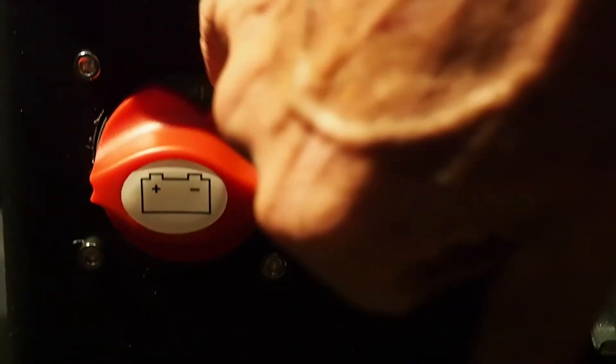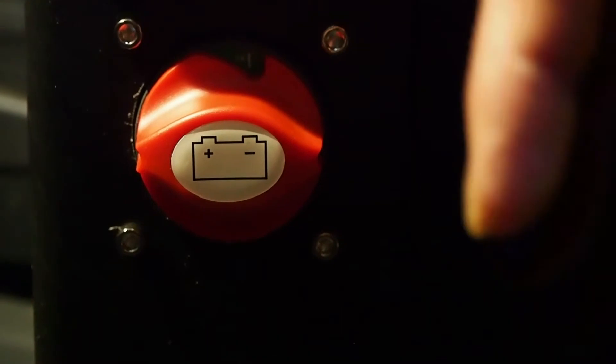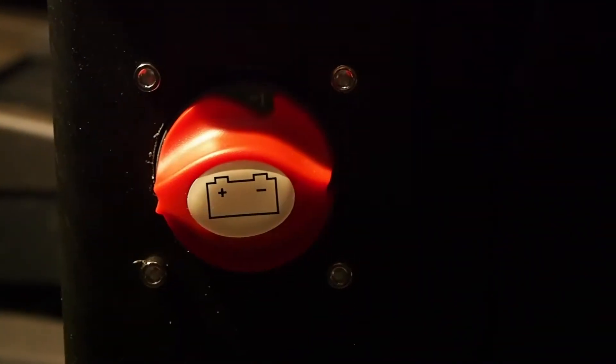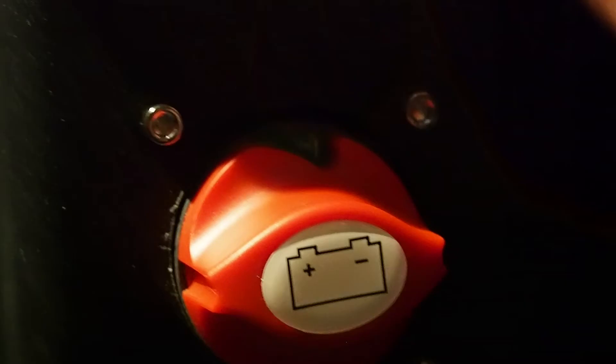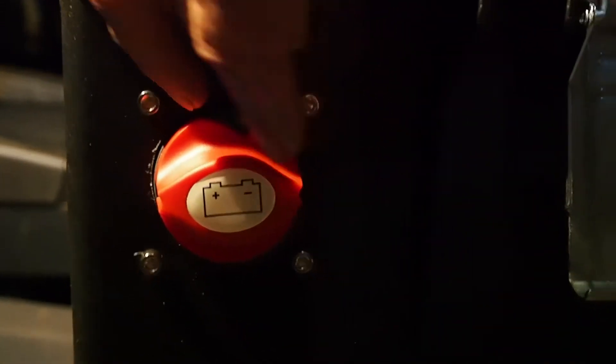The first thing we did was create the master switch right here — 250 amps. If you guys need any help about drilling holes with hole saws, just leave a comment below and I'll be glad to answer questions or even create a video for it. This is just an on/off master switch. We drilled a hole — two and an eighth, it should have been two and a sixteenth but I only had a two and an eighth, so we improvised a little bit. Then I turned it around and used the base inside as a template to drill the four holes.